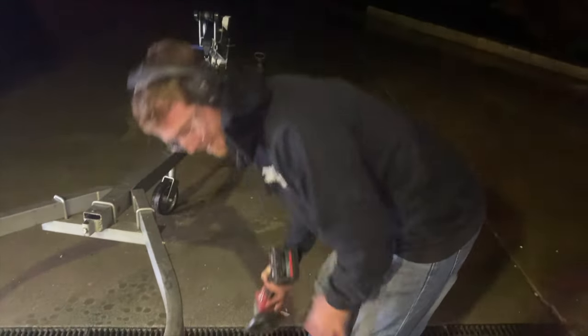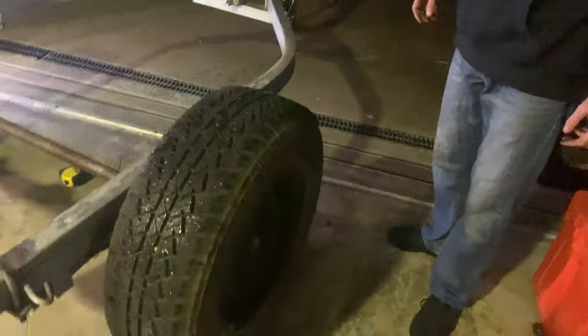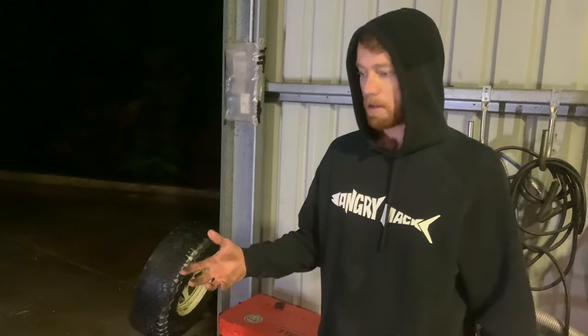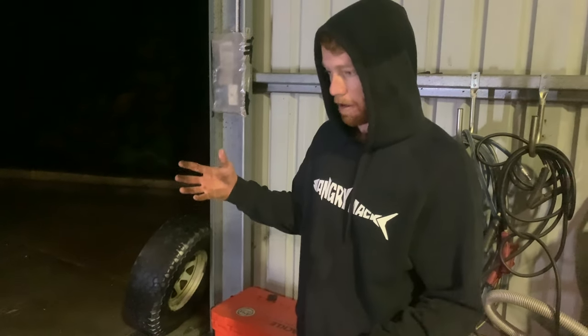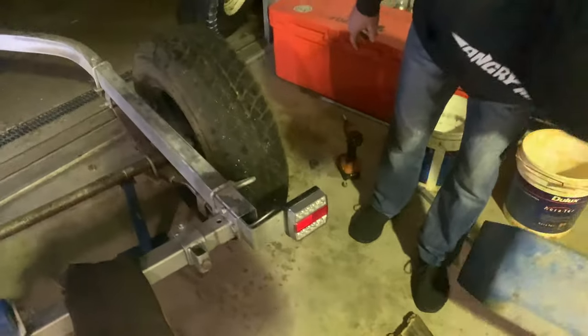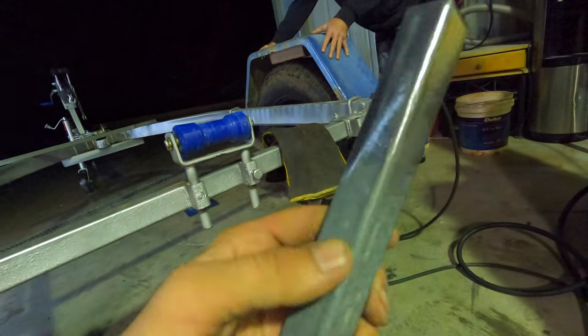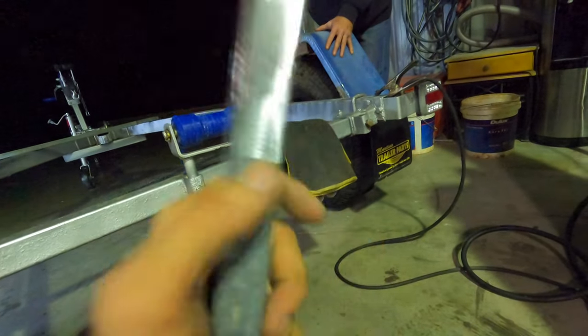Let's get these mud guards on. We've got some galvanized tubing - I believe it's 10 or 12 by 12, maybe 15mm - off an old fence post, and that's going to be our structure for the mud guards. We've test fitted one of the tires we'll probably be running - it's a basic steel wheel off a standard four-wheel drive, a 245. The reason we did this is so we can base the new guards around this tire since it's a lot thinner and the guard will fit a lot better. The length is 300mm and I've ground back the galvanized steel so we can create a nice weld between this and the actual trailer itself.